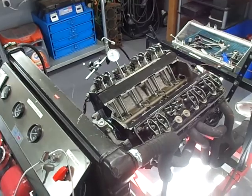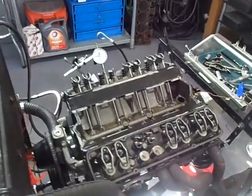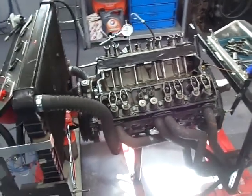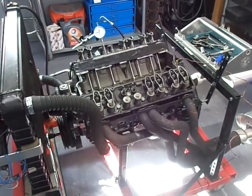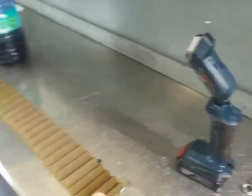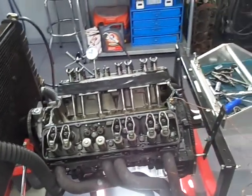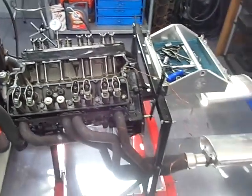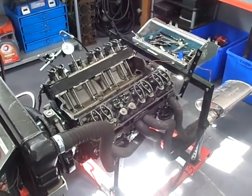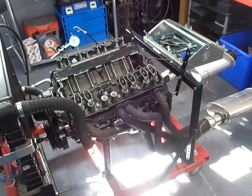Once it goes back together, all the lifters are coming out, we'll check the lift on every camshaft lobe, make sure that's good, and give her another run. This is a widespread issue — we're not the only ones having it. One solution is to put a roller cam in it, but the roller lifter is just as likely to collapse on top, so that doesn't necessarily solve the problem. At least because of the precautions we took, we didn't destroy the rest of the engine. If you found this helpful, please give me a like, ask questions in the comments, and subscribe to the channel. Thanks for watching Gold's Garage.